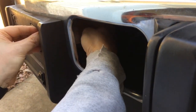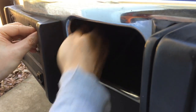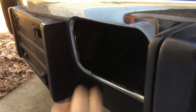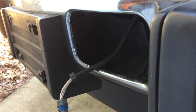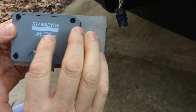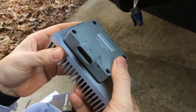I keep one of these in the truck as an emergency for those situations. I had to change it out and I'm going to show you how to get the resistor out of this, but I'll take the whole thing off and describe what I've got here. I've also done the upgrade on the injection pump to handle this upgraded type of Stanadyne pump-mounted driver, part number 39405, and I run with that particular one.